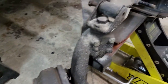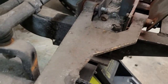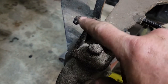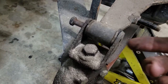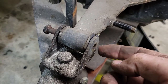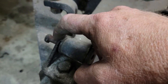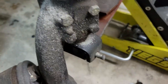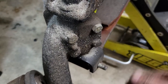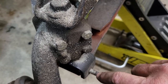We got the wheels off, we got the shocks off, and we have loosened the majority of the hardware. Right here on the upper clevis, we took that loose. Doesn't matter which way it goes in, but we want to drill the front hole half-inch. The back hole is going to remain three-eighths. Same down at the bottom — you're going to push that in, drive it in, beat it in, whatever you got to do. We won't have this problem anymore because we're putting stainless shoulder bolts in, so they should easily slide in and out.